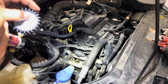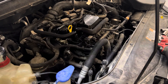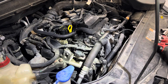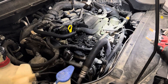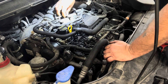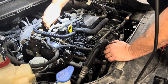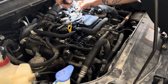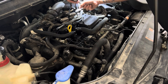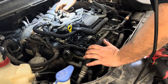I put it up to 20 pounds and it is sitting at 17 pounds, so it has dropped three pounds. The whole bottom of the engine is covered in oil. But I am not really too worried about the oil if we have coolant intrusion, because it will need an engine. And it didn't have any misfire codes, but this is what I am going after, so we will see.